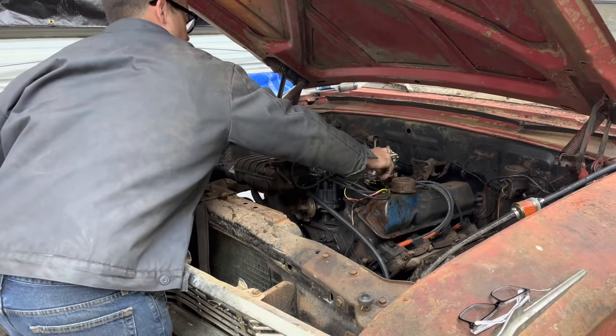It's like you pull it down and this wheel takes off going forward, and all of a sudden it hangs up, and then you pull it down a couple more gears and then it takes off going forward. The throttle linkage on the car was kind of holding it open too far, so I just adjusted it, turned the linkage out just a little bit farther. We got way too high of idle, but I don't know what's up with this thing.